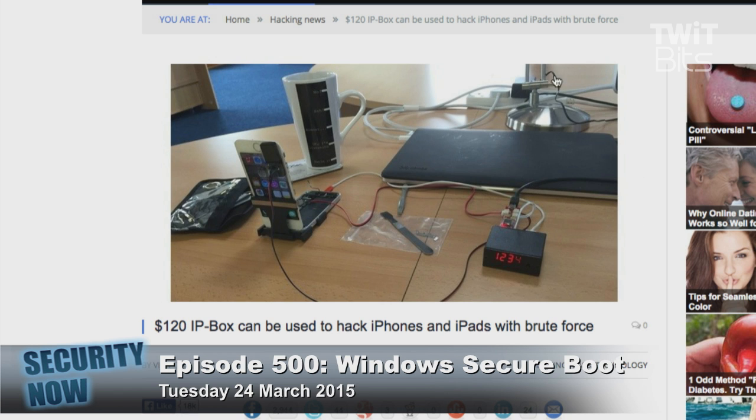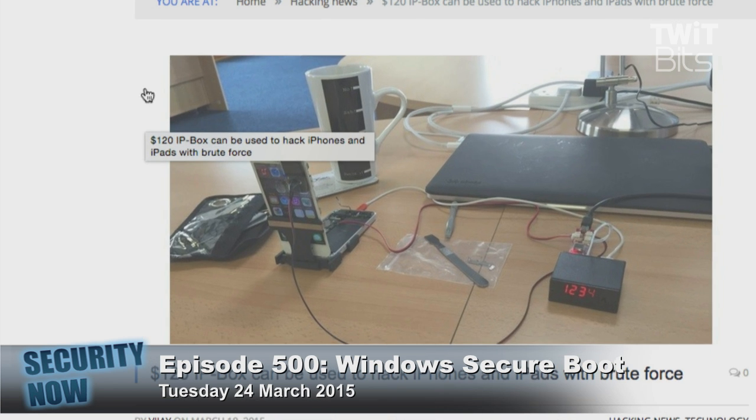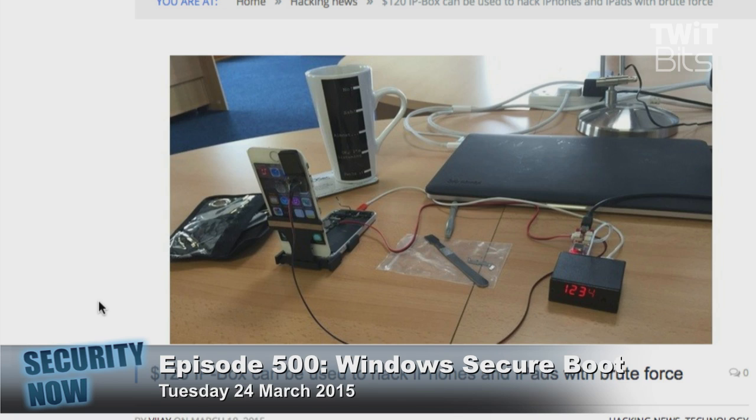Apple made a little mistake, and this is why this is such a perfect example of real-world security. Apple's programmers said: if they don't enter the PIN code correctly and erase data after 10 attempts is enabled, then we increment a counter, which we store in non-volatile memory, so that we're continuing to increment it until they enter it correctly, in which case we zero the counter. What these guys did was realize they could break power — disconnect the battery so fast after a guess failure that the phone was in the process of recording the guess but wasn't able to complete that update. Just a brilliant hack.